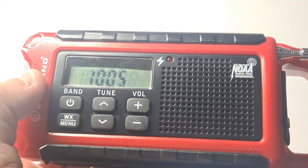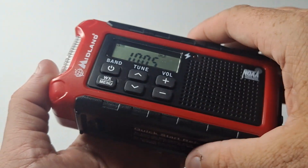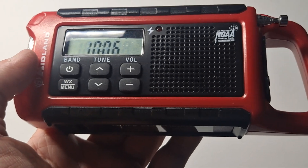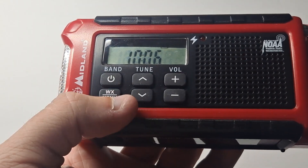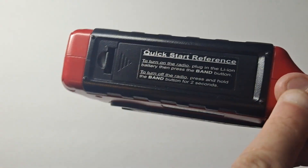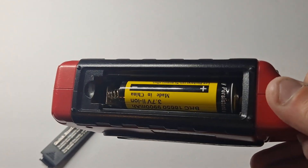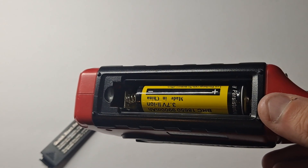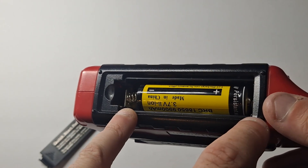If you have a generation-one like this, you can modify it — it's possible. When you open up the case the crank comes out and the whole unit separates in half. On the inside there's a pigtail with a plus and minus — a little red and green wire, or red and black — going to a tiny little board. You can cut the wires off the connector side and solder on an extension, so one wire goes to each contact. The contacts themselves I salvaged from something else I took apart — it might have been a flashlight or an old camera.